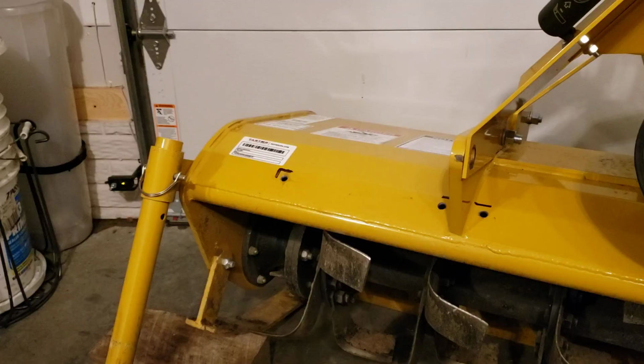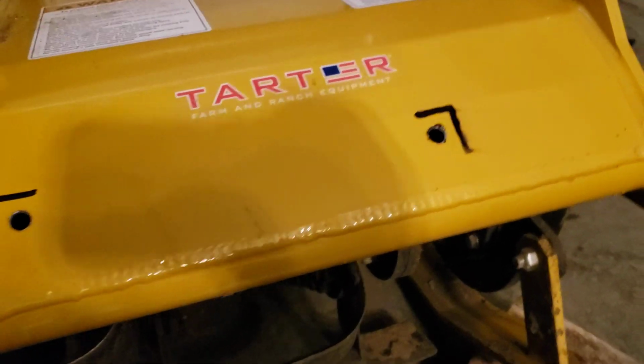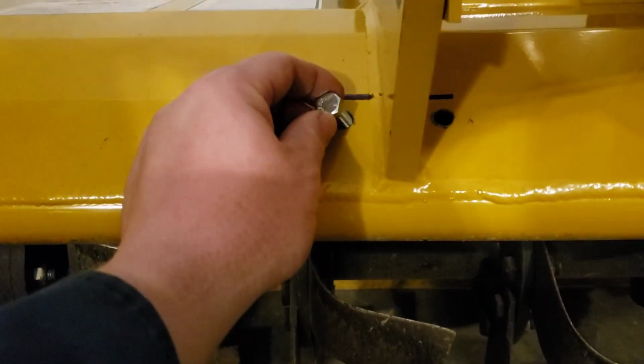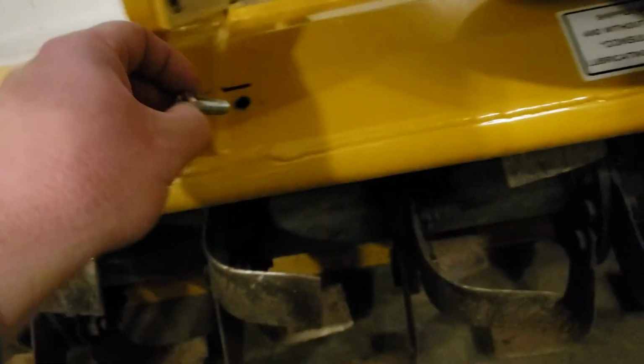And all right guys, so we're back. We got all the holes drilled. As you can see, I had to take out the pins like I thought I would. I ended up using a step bit for the last step, just so I could deburr the holes, and of course, I cleaned them up. This is a 3/8 inch drill bit, and I'm assuming these are 1/2 inch. Or, I thought these were 1/2 inch, but I guess not. But I just made sure they all fit.